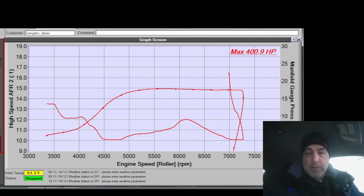So it's on speed density though, so I want to make sure that I'm watching the air fuels as it warms. I fired it up for a few seconds earlier, and I saw that it was running a little lean as the RPM oscillated some, so I need to adjust the coolant temp table for that.